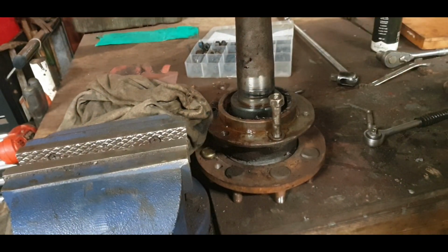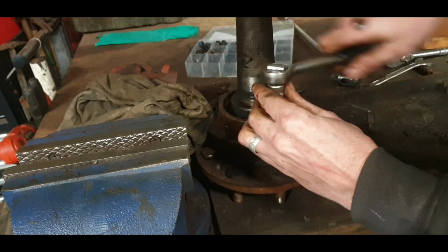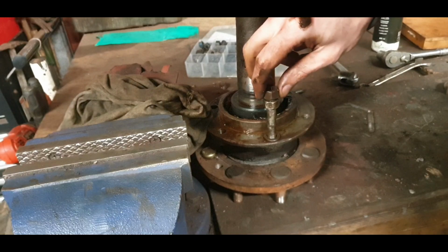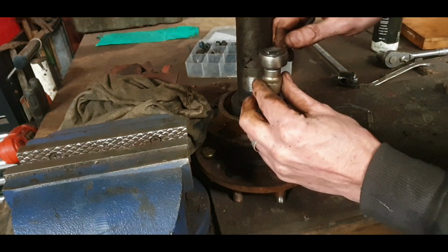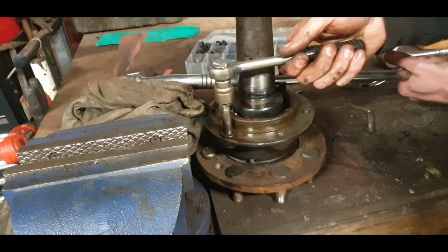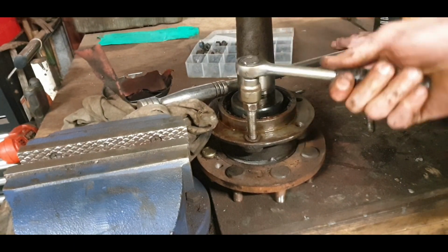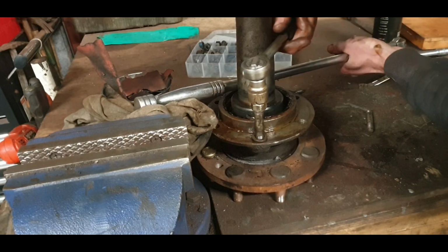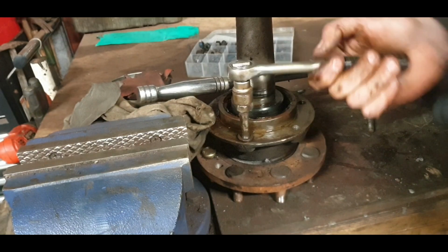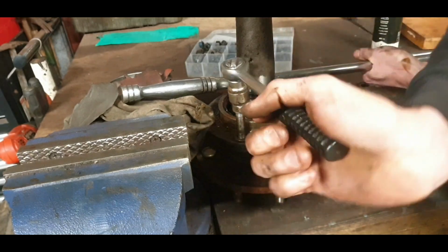Okay, expose a bit. I'll use the other nut to screw it on top of that, and we'll screw the whole lot. The top nut then to butt up against that, hopefully screw in the stud. Oh. There. That's the least destructive way to do it. Instead of grabbing it with vice grips and leaving marks on it. If you do that with every one of them, you'll end up making it harder to get everything to fit together.